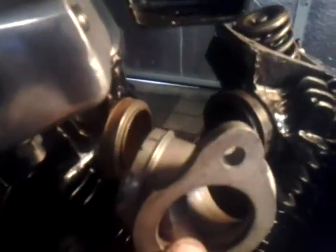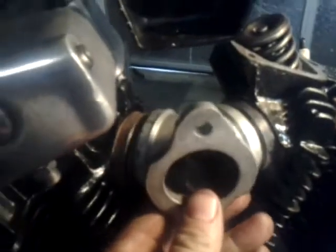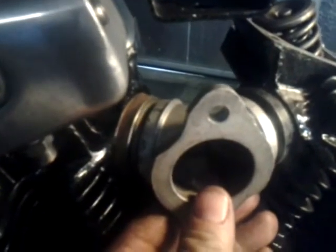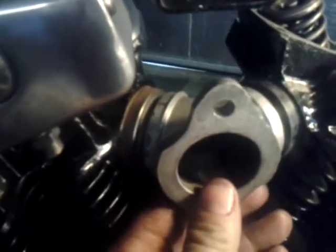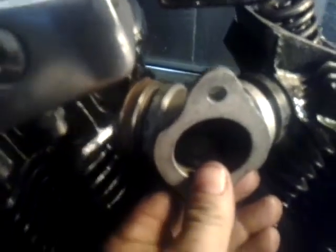It's not going to be perfect, but the closest you can get it to perfect the better it is. You just turn your head one way and turn the other head the other way. When you get it nice and close, that's when you want to do your first torque on your head bolts. Then when you go to put this on, it will line up real nice. There it goes, that's going in nice.